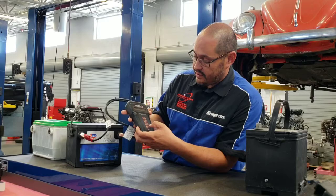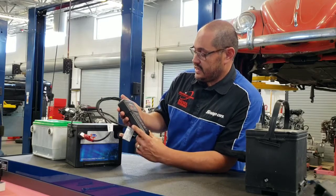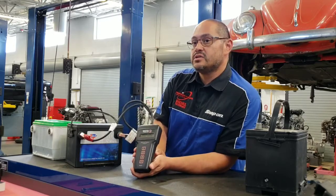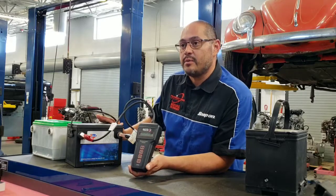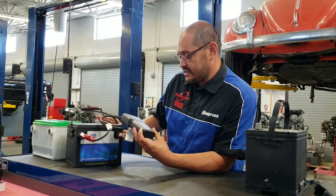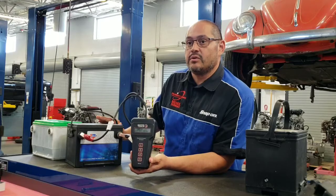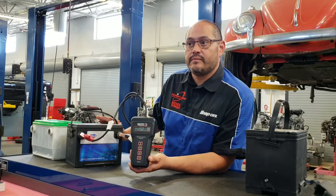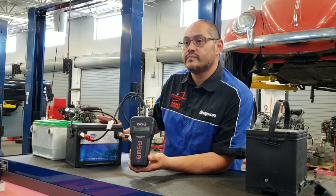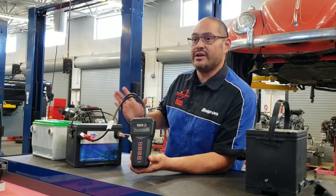It's going to start testing the battery. It says this battery has 88 cold cranking amps. So even though the voltage is good, it's not capable of producing enough amperage to start the vehicle. This battery is at 16% of its capacity and it's telling us we need to replace the battery. Just because the voltage is good doesn't mean it's healthy — it also has to be able to deliver enough amps.